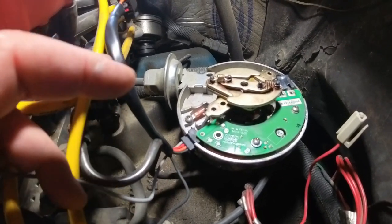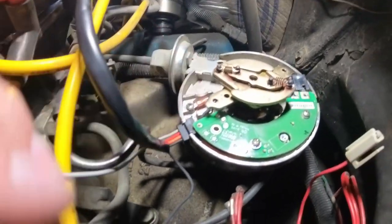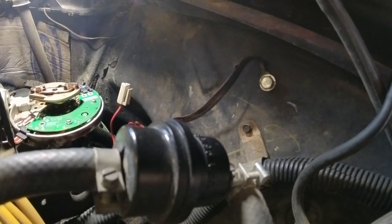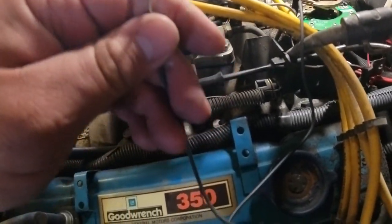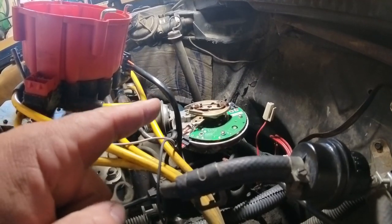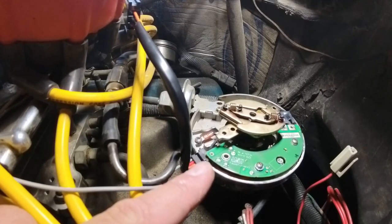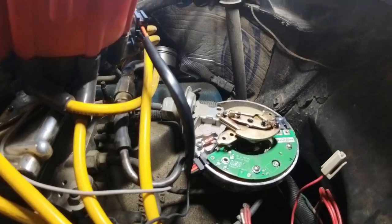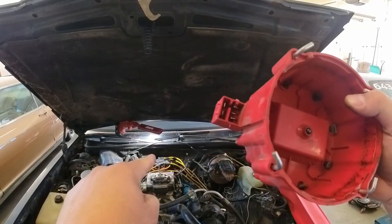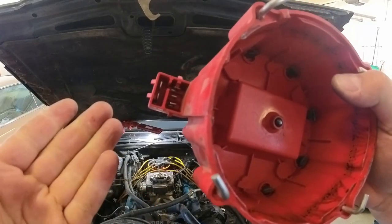Here's what it looks like with the module installed before the rotor goes on. The connector that goes up to the cap and coil sits in exactly like it's supposed to from the factory. I've got the long coiled ground wire here — I'll probably zip tie it shorter and hook it up to the factory braided engine ground. I'll get the cap and rotor on first so I don't drop anything. One thing: because there's a magnetic pickup down there, if you drop a screw it's going to get stuck to the mag pickup — not harmful, just annoying since you can't pick it up easily with another magnet. The connector from the module to the cap has a notch and matching slot, so it really only goes in one way.